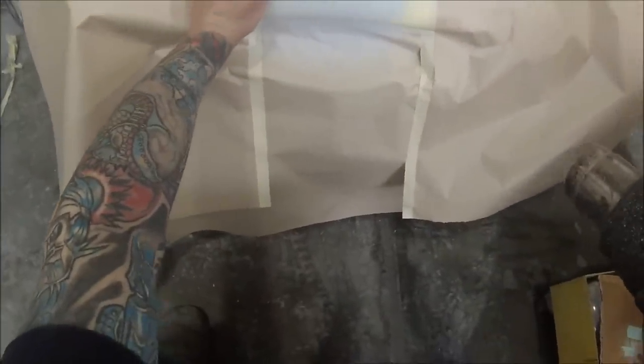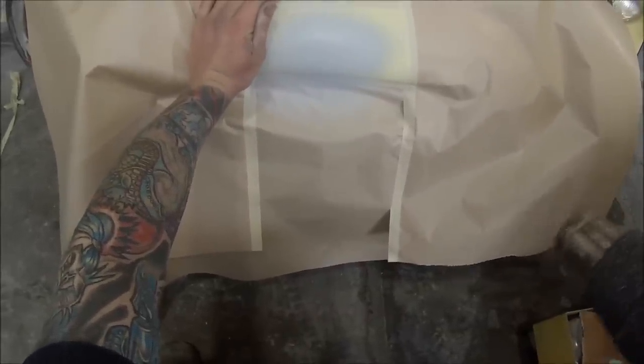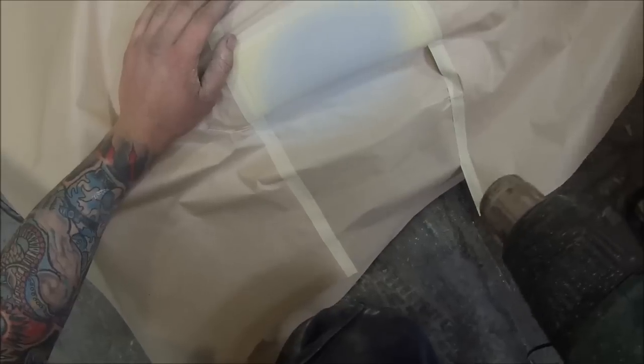Apologies about the camera angle there. I'm going to get a little bit too close there, and now I'm just using the heat gun to dry it down. I actually decided to leave this drying time in just so you can see with one thin coat how long it actually takes to dry this 1K — it's actually quite quick. Just remember that it is at 1.5 times speed, so maybe just add an extra 30 seconds to the drying time. That's about all it needed, and that's about dry down already. I'm just feeling it with my hand to double make sure that it is nice and dry.